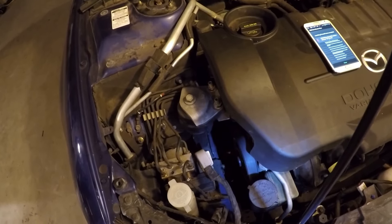Once I took off the passenger side wheel, the next thing to do is to take off this plastic cover so that we can gain clearance to the crankshaft position sensor. There are five Phillips screws holding it — one of them was missing. This whole thing is one piece. Looks like we need to take off five Phillips screws. The plastic cover came out fairly easy.